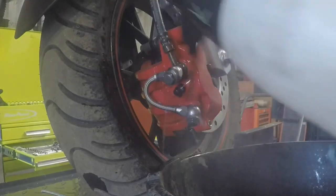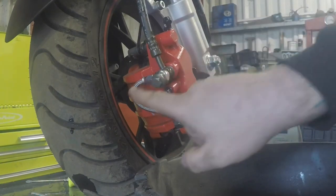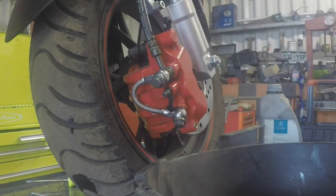It's quite often worth giving it a little run up and down the yard - it bounces the fluid around and makes all the air come to the top. Go do a mile on it, come back and bleed it a bit more - you'll get a bit more air out. So just a quick recap: we've joined the middle piston to the outside two pistons using this little bit of braided hose. Check for leaks, check everything's tight, clean everything off. And that is how you unlink your Benelli 125 combined braking system. Thanks for watching - there will be more videos on sub-frames, exhausts, paint jobs, handlebars, handlebar grips, tail tidy, and lots of things coming. Thanks for watching, click subscribe, and see you in the next video.